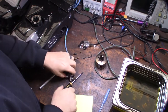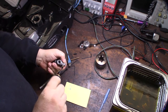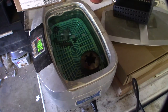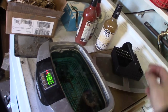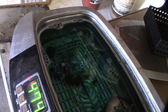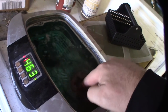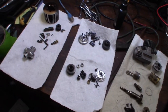I'm making a note of the high speed and low speed needle positions so I know where this guy had it set. Most carburetors don't actually have a built-in return spring - this one is kind of interesting. I have a second ultrasonic cleaner I'm going to use with water and dish soap. I actually created a little basket for it - it's on my Thingiverse page. I wasn't really wanting to mess with the anodizing on the head since it can remove the anodization.